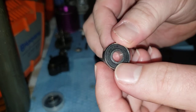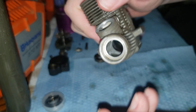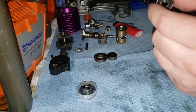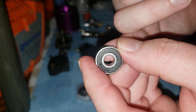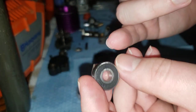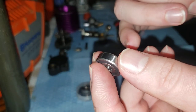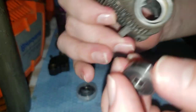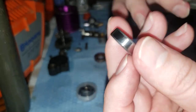So it doesn't matter what seal you pop off — you can pop off the back or the front, it doesn't matter. It'll be the same either way. But usually when you buy them from Avid, or Boca, or Acer, or whoever else, they usually pop out one seal for you. That way you won't pop out the wrong one, because it'll be the same thing on these except the ball bearing side is facing out, just like I've mentioned, and the cage side is facing in. Because they're steel caged — in and out — it doesn't matter what way you put it in there.